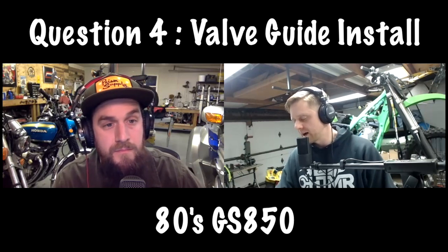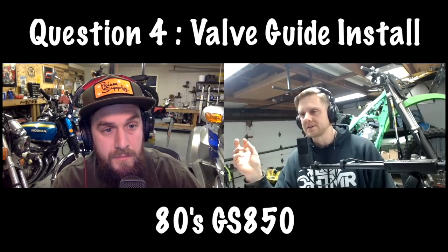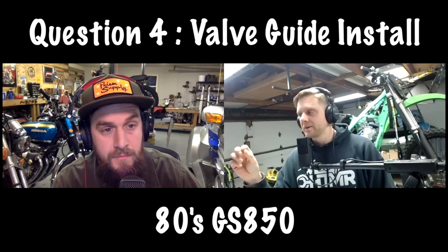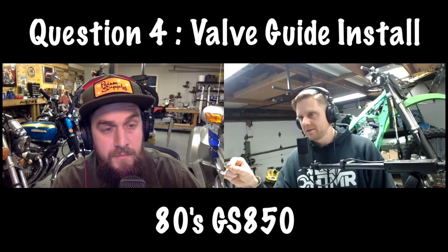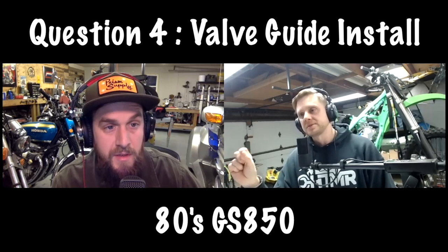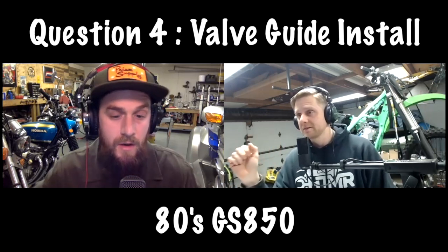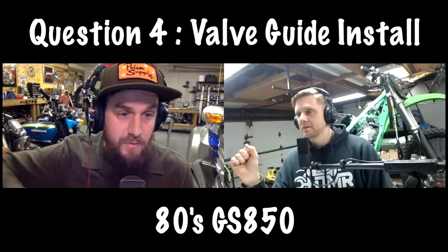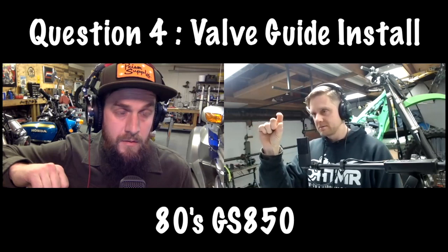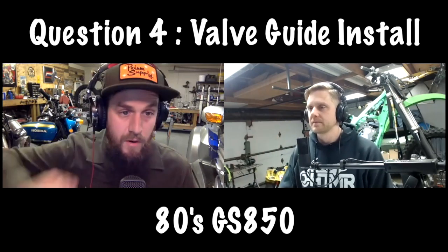So he has the guides and he has the reamer. So taking the guides in and out is easy. Yeah. Right. But how do you go about reaming the guide? So you would measure first. But I'm saying, like, you would do it with a regular drill and you just have at it? No, it should be like a hand tool. Okay, so there's a pilot on it, I'm sure. Uh-huh. And then you just kind of walk it through. Yeah, like you walk it through.